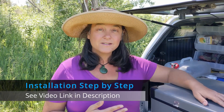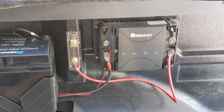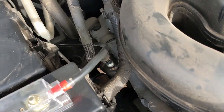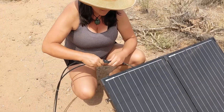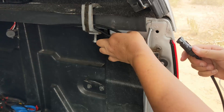If you've just come across this video and you're wondering how we're running this 12-volt cooler, we'll refer you to our installation video in the description below. But here's the short version: we have a Renogy dual input DC-to-DC charger that pulls a charge off our starting battery while we're driving, charging a 50 amp-hour lithium iron phosphate battery. When we're somewhere for a few days and temperatures are higher, we can attach a portable solar panel. It's that simple.